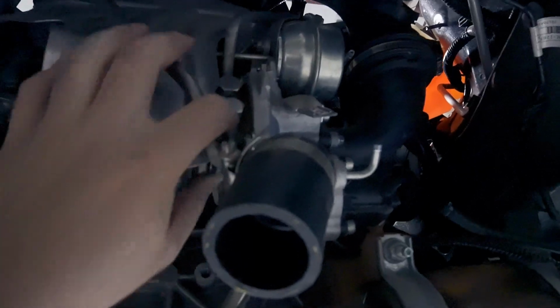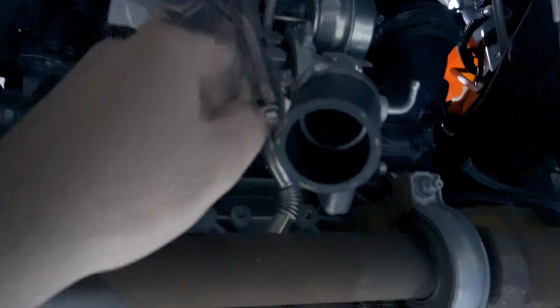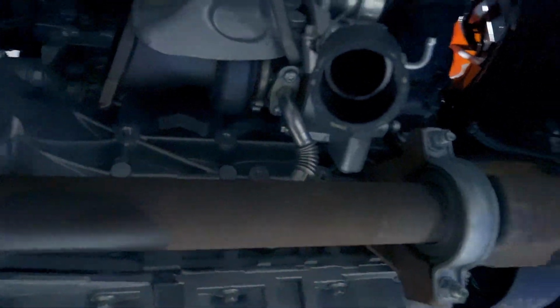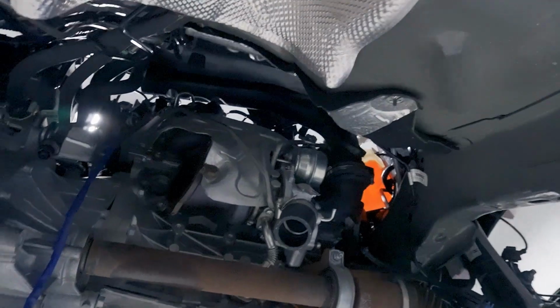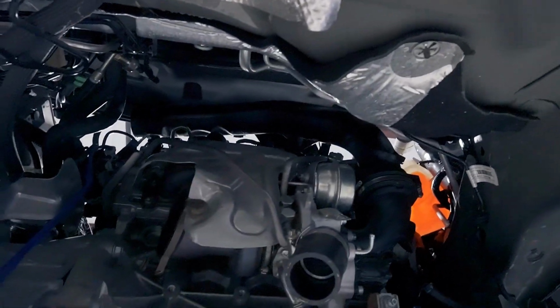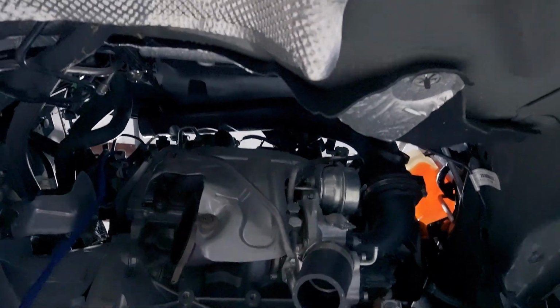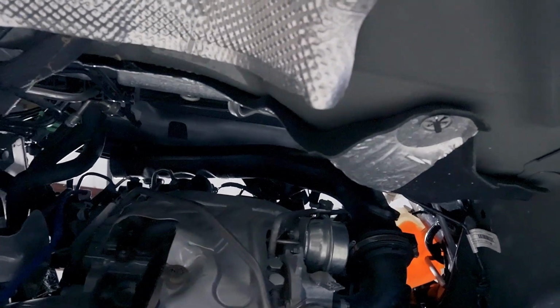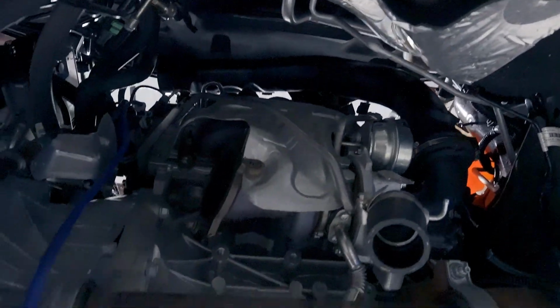So the next step, which will be in the next video, we're going to remove the oil feed line on top and remove the oil drain line here. And then with the coolant lines out of the way, we'll be able to remove that heat shield, and then we'll be able to disconnect the manifold. I think I'm actually going to remove the turbo off of the manifold first and then remove the manifold. The reason I'm pulling the manifold off is because we're going to be swapping it for a ported manifold.